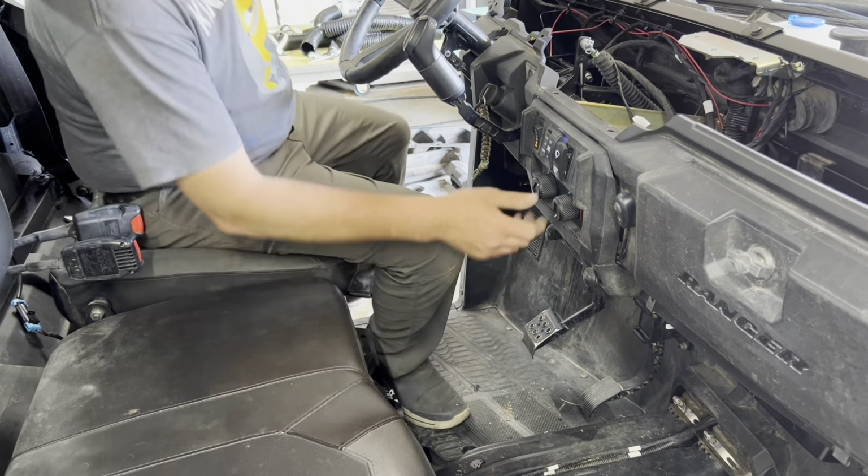We're going to go to the back of the motor. Okay, we're back here at the engine, and there's a little screw right there. I'm going to loosen that, and then that's going to let the air out of the head, and then we're going to go back up front and keep filling the radiator until solid coolant with no air bubbles come out of that bleeder screw.